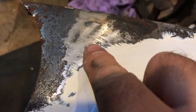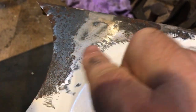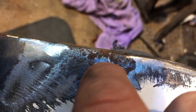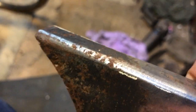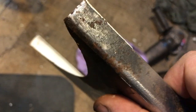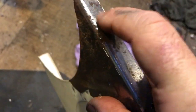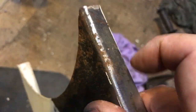The flap wheel has taken the paint off, I've sanded that down and it's reasonably feathered, though it still needs to be sanded a little finer yet. You can see the texture of the metal - this isn't just surface rust, this is corrosion that's gone inside. There are tiny little pits all over. When I spray the primer and paint on, unless I spray about 20 coats of high build primer, that's going to show through and be rough. The surface rust will sand down adequately, but these pits need attention.